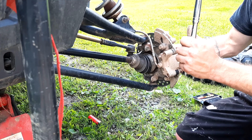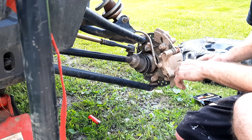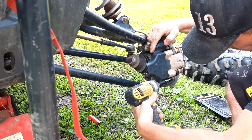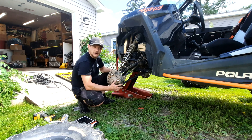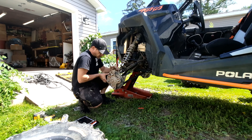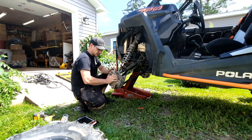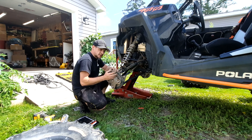What you do is take your allen bolt and tighten it in until you can barely turn your rotor. Then set yourself up so you can get a good half turn — I start either straight up or straight down so I know exactly where 180 degrees is. Then back it off about a half turn. The caliper releases again — a little rubbing noise is pretty normal and it'll wear itself out.